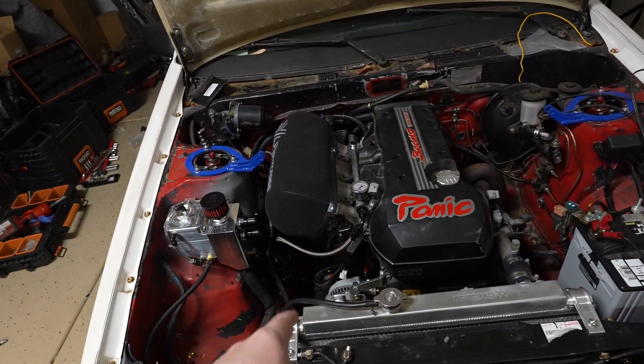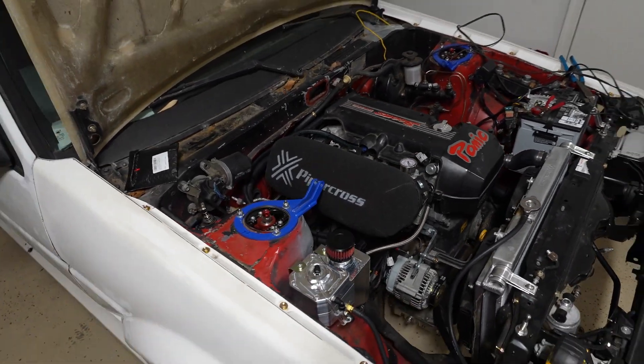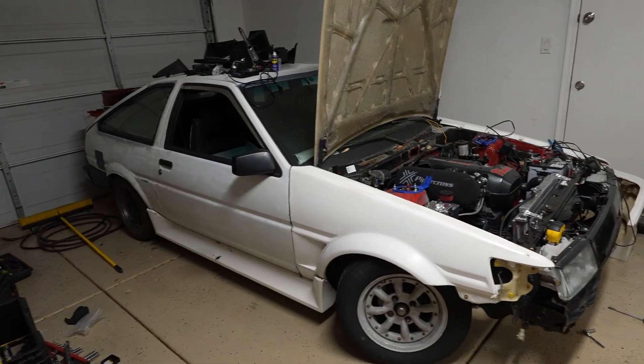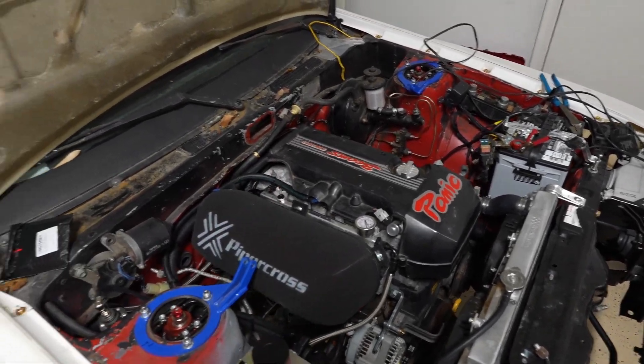There you go — that's everything you probably need to know about an oil catch can on a Beams 3S-GE, how to hook it up and all that. I should mention that the dual vented setup can also work for a stock ECU, I just think recirculated is better. This was the last part I needed before getting this car tuned — now it's just idle control stuff and tuning, and I can finally drive this car. If you're new to my channel, this is my project AE86 hatchback resto-mod called Cream Puff that I've been working on for about four and a half to five years. If you've got other Beams swap questions, put them in the comments. Thanks for watching, see you next time.